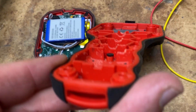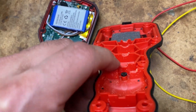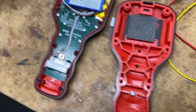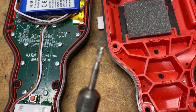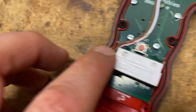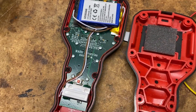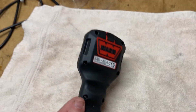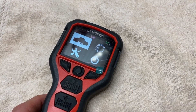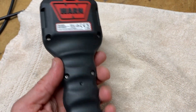With the Dremel tool — just a standard Dremel with a cutter bit at low speed, not trying to melt plastic — I cut a channel right down the center and ground down one side of the post. That's all it needed. I hot-glued the wire so it stayed in place once routed to the top and looped around. Now for the big test: all eight screws are nice and tight, it's sealed up just fine, and hot glue was added in a couple more spots to secure the wire. The unit is up and running just as the manufacturer intended, and it's still as waterproof as when I got it.